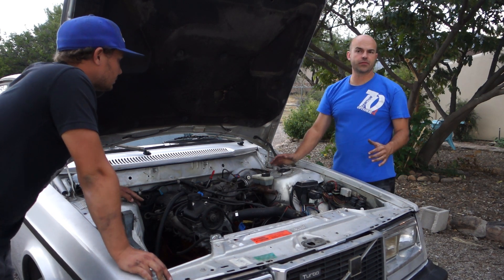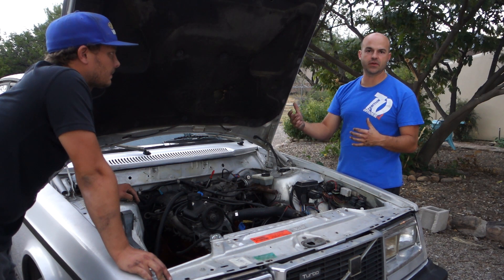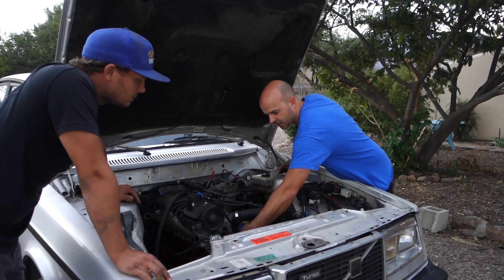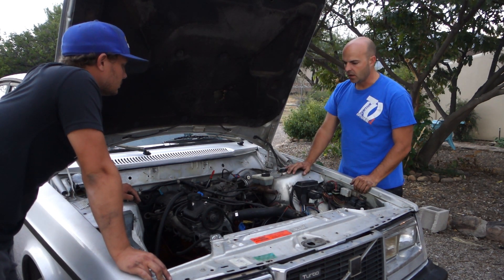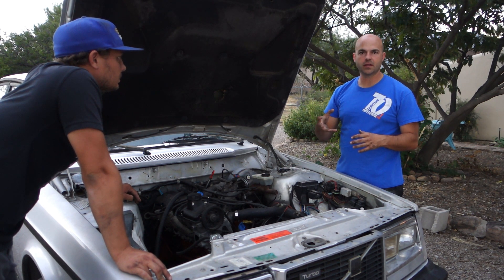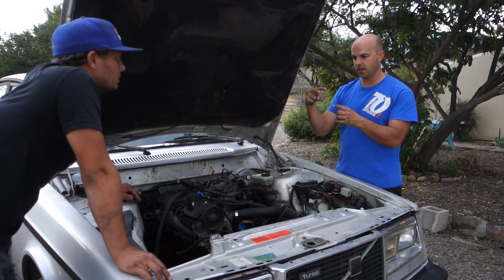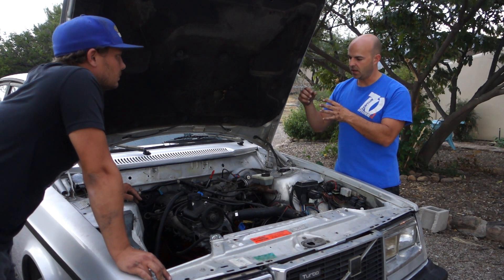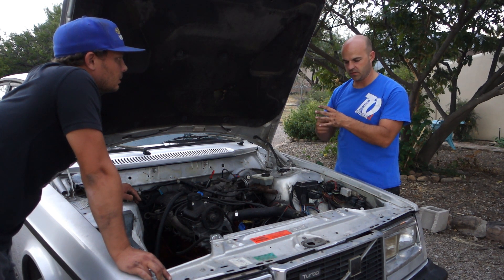You also need some sort of crank position sensor, some sort of trigger to activate the ignition when it needs to go off. I have one plug that goes on the side of my distributor — I'm not exactly sure what kind of sensor is in there. But on the RX-7, it has a trigger wheel on the crank with one tooth that sticks off the top and a bunch of teeth on the inside. One sensor reads the home tooth — the single tooth — and the other sensor reads all the individual teeth.